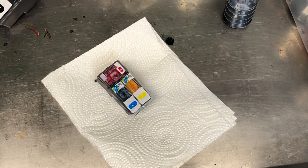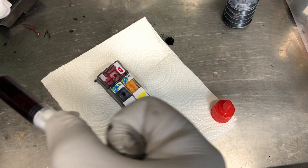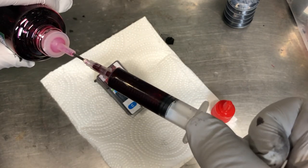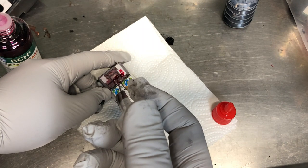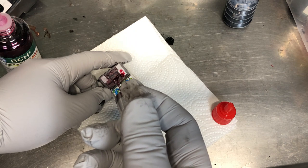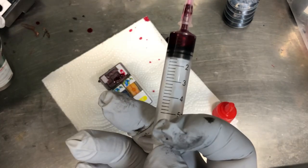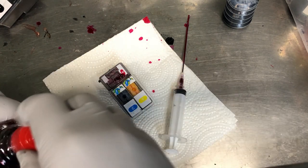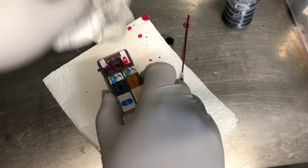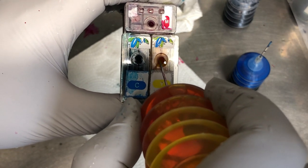I'm going to fill it a different way. If you bought this kit, you got a syringe and needles. I'm just going to put in the ink and measure it. If you check the link I provide in the comments, I bought the 4 ml as the max. You need to be patient — just do it slowly, don't push it down hard. You can see the ink is already way up. So I did about 3.5 ml. The number is not always the same because it really depends on how much ink is still left in that chamber. There are many ways to get this sponge wet — as long as you get it wet and when holding it, it's not dripping ink, you're good.